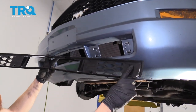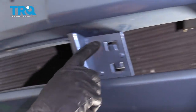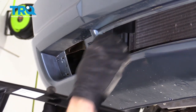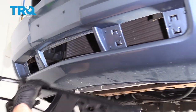If you look at the backside of the grille, you can see those areas that are gonna have to get pressed through the bumper cover all along the top there. Pay special attention to the center area, approximately where the license plate would be. There's a little slot there, and these tabs need to go in there. That's where we're gonna start — with the center. Line those up, and once we do that, we'll continue.